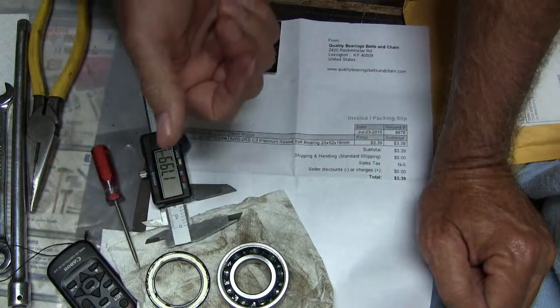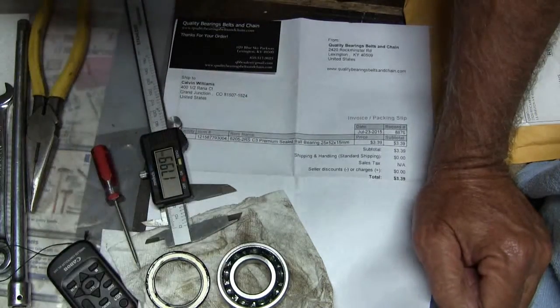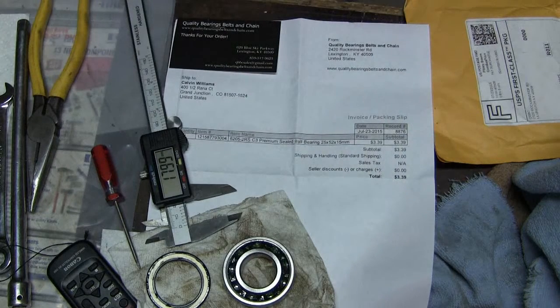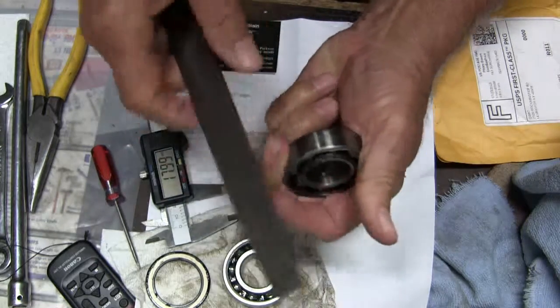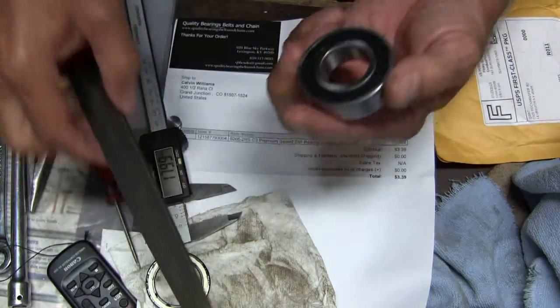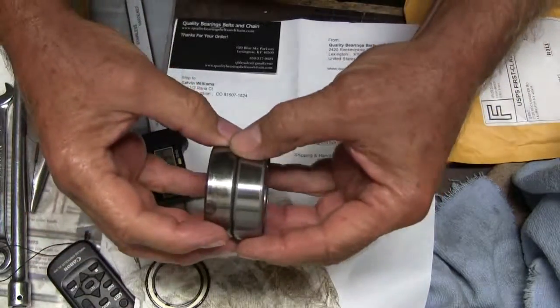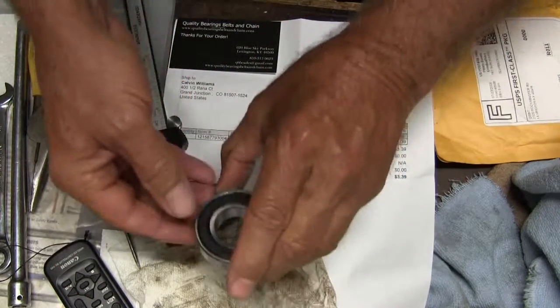The 9-ball is going to be a smoother riding. So, $4, or $3.40, or $8, or $7. I just don't know about the bearing quality steel. Let's take a file. I did not mark it — seems to be the same hardness. You mark it with a file — it's too soft. So I think I may have just found a replacement at half the cost on my next changeout.